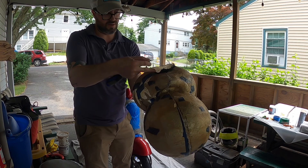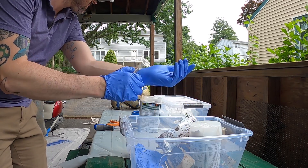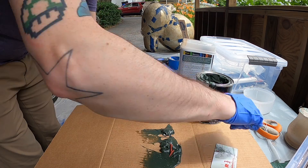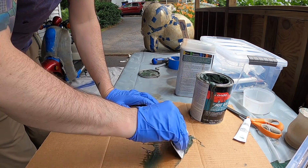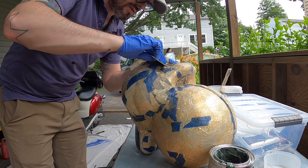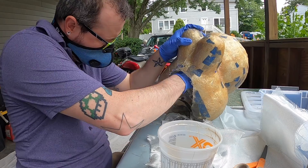Now we can fiberglass all that and get the inside looking good. What I'm using now is called Bondo Glass — it's a mixture of Bondo and fiberglass. It has fiberglass strands in it so it's a little bit harder rather than just using regular body filler or Bondo. It's more rigid. So we're building up some spots so we can smooth it out. Now it's all about making it one whole structure — fiberglassing all the pieces together so it's like one unit, so it's not going to break off while I'm on the road.